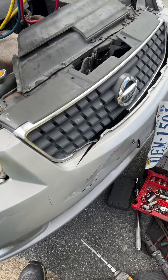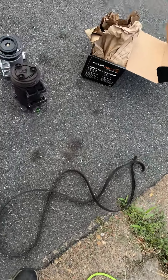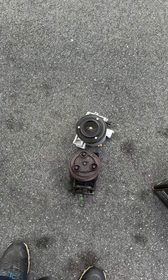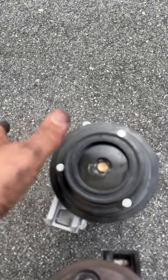I was pulling the belt out — and there's your belt, broken. So the next time you have a belt that broke, find out if it's the tensioner or one of the pulleys. Take your hand on each one of the pulleys and spin them just like this — you can do it while it's on the car.